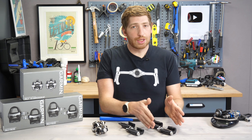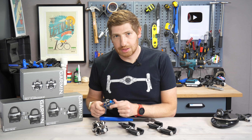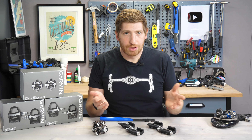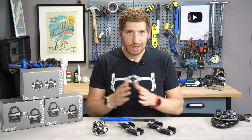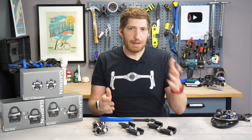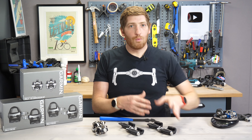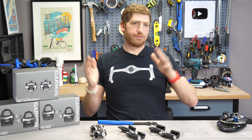Inversely, if you're somebody doing road cycling for the majority of the year but maybe has a gravel bike and wants to use SPD on that but SPD-SL on your road bike, this makes perfect sense. Garmin sees the pedal type swapping more as a seasonal thing, and I would tend to agree. Whereas if you just want to swap a pair of pedals between multiple bikes, that takes like 30 seconds on average. There are many power meter options on the market, including pedal-based ones — on the Keo road side you have Favero Assioma pedals, on the SPD side you've got the new SRM X-Power ones, and then of course the PowerTap pedals which have been temporarily discontinued.